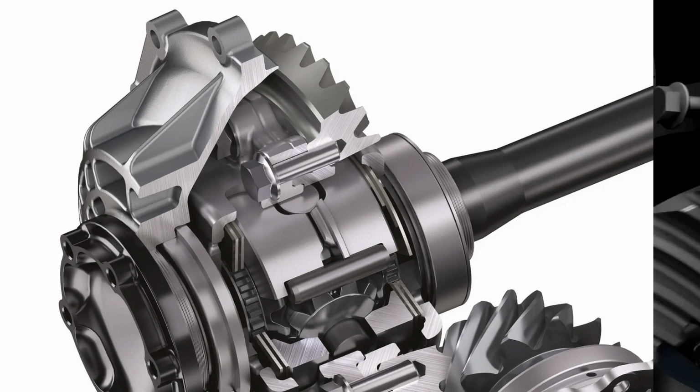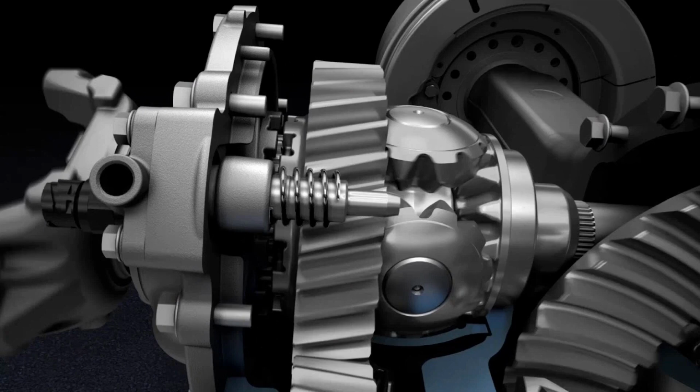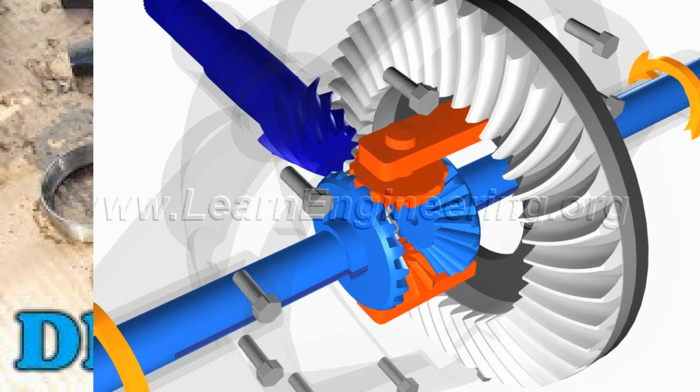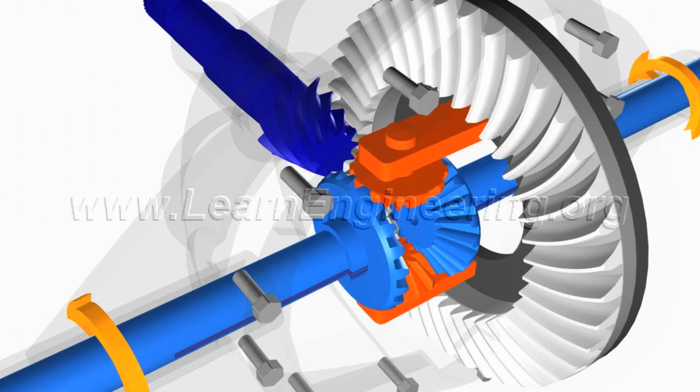A friction differential made with your own hands is a little more difficult to make than simply fixing the satellites. But such modernization will not only improve the passability of the car in mud and snow, but also will not change the operation of the unit on hard surfaces. One of the variants of such a device can be assembled from two brass or bronze bushings and a spring. Their dimensions will depend on what kind of car transmission you are modernizing. Therefore, the work begins with the removal of the unit and disassembly of the planetary gear. After that, you can take measurements, order the manufacture of bushings and select a spring of suitable dimensions.